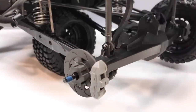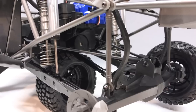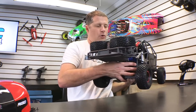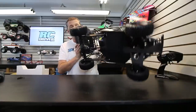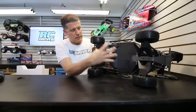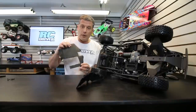It's got the upper cantilever sway bar setup, and what's really, really cool, it has limiting straps from the factory. We've got rubber limiting straps here so that axle can't overextend if it gets pulled down and possibly break anything. And now the rest of the stuff that I have to talk to you about is located under this panel here. So I'm gonna stop yet again. I'm gonna go pull this panel off so I can start to talk to you about some of the stuff going on under here. Okay, so it took about a minute to pull off the lower cover here.